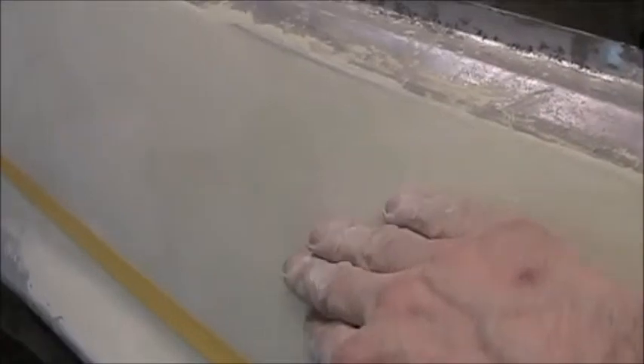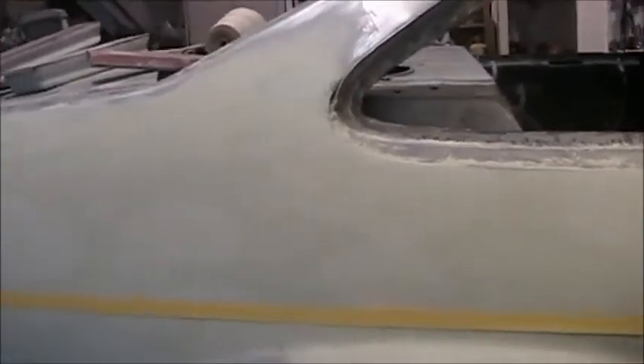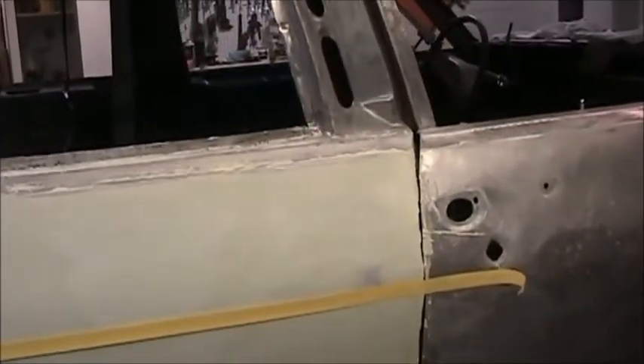Last time I had so many low spots I just went and hit them, then sanded down to try to meet where it was before, then went over the whole thing. There were still little places that — I'm not going to sand anymore, because I think that's what I might be doing wrong — sanding it too much. Not much of an update visually, but a lot happened. I'm hoping once I get this quarter done, I'll have the feel of the body work again.